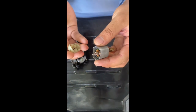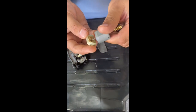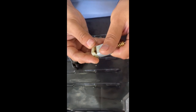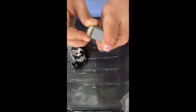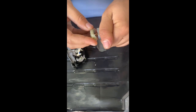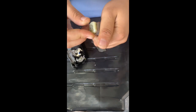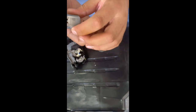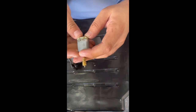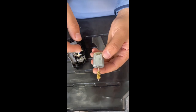Your next step is to put your motor back together. Do this by pushing the pin through the brushes on this side and aligning it with the hole on the other side, then gently push it in and it should just pop into place. There you have it — that's the motor part of the central locking repair. I'll get into how to put this all back together in the next shot.